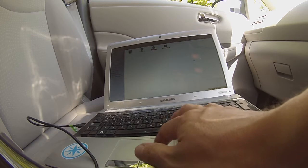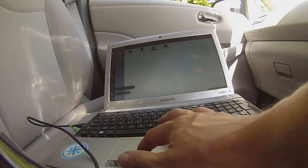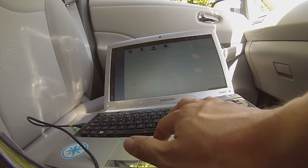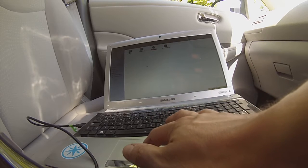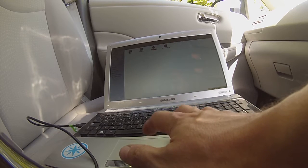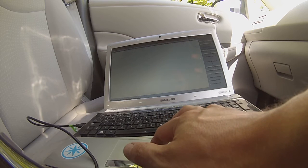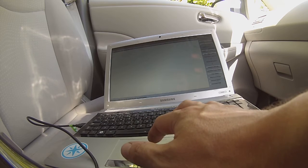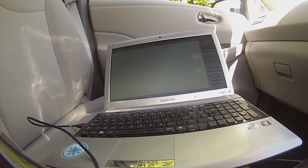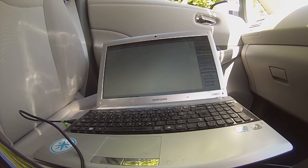Well, is SavvyCAN gone, or was it just my computer being a goose? Yay, SavvyCAN is gone. So let's try next idea. Foot off brake, restart SavvyCAN, connect to GVRET, connected, set CAN bus speeds. So let's go for a take two. So foot on the brake, car power on.